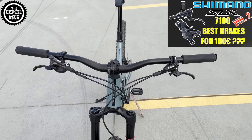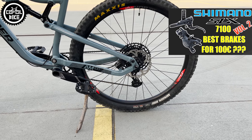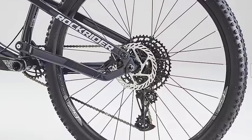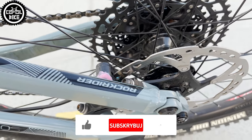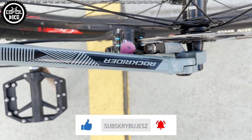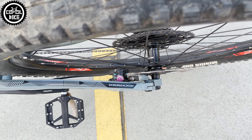The stock bike has a good spec overall, but there are a few downsides. The first is the rear brake — the stock Rockrider has a two-piston caliper at the rear and a small 160 mm rotor, which is definitely too small for an all-mountain bike. After installing a 180 mm disc, it turns out the caliper does not fit into the rear triangle. It can be sanded down as in this case, or you can install an even larger 200 mm disc.